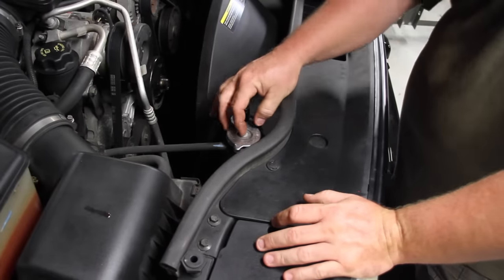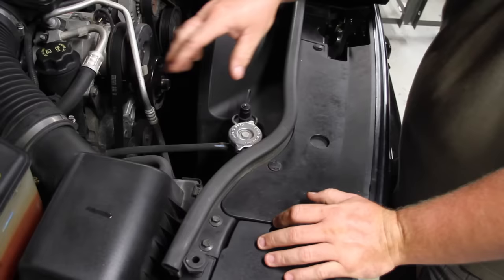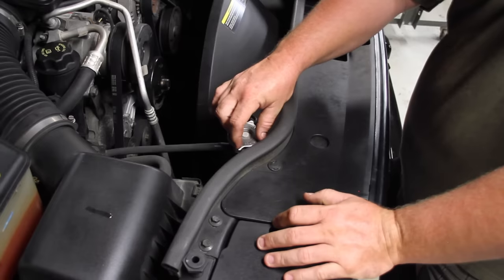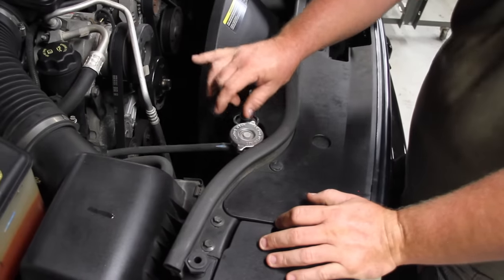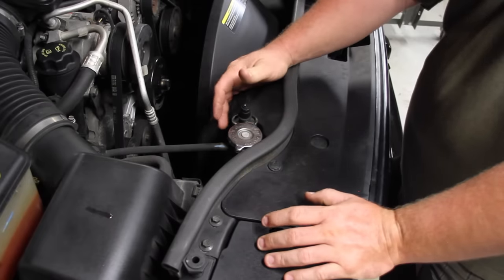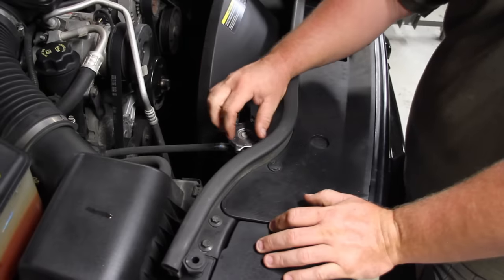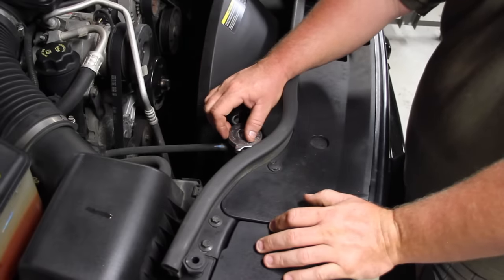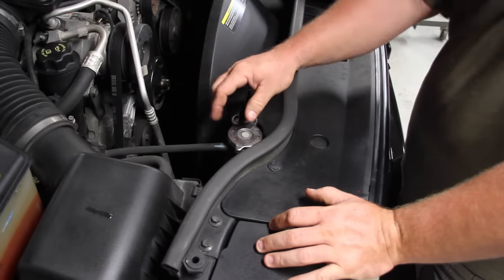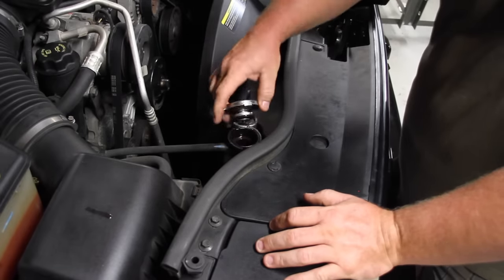The first thing you want to do is locate your radiator cap or your pressure tank. You need to diagnose which cap is your pressurized cap — in this case, it's right here. If you're running out of coolant, make sure the system is full before you start this test or you'll never build pressure. Also make sure the engine is cool before you pull the cap off — if the engine's hot, it could be a bad day. This thing could explode and you could end up in the hospital. Always make sure the coolant is full, though it doesn't have to be completely topped off.